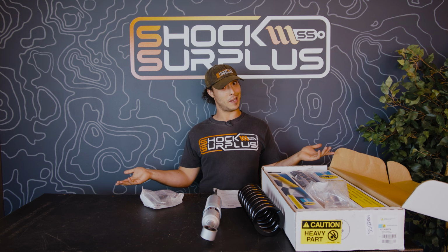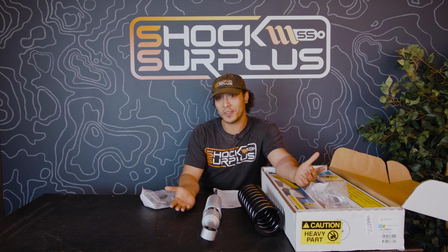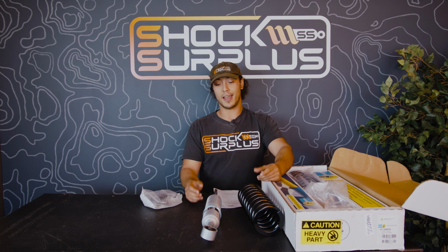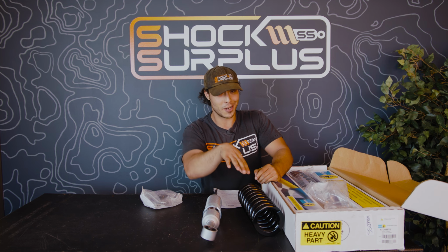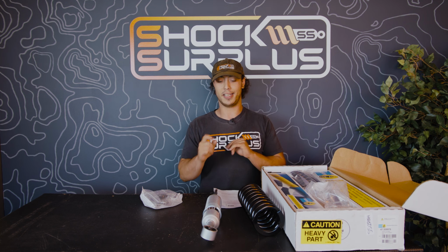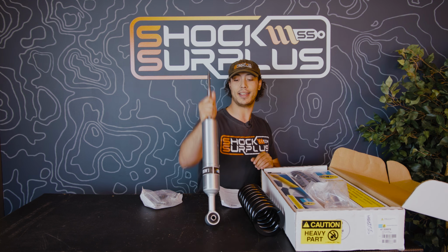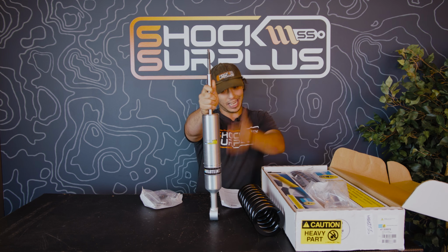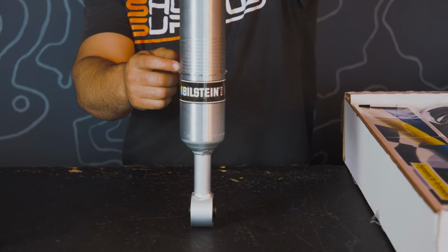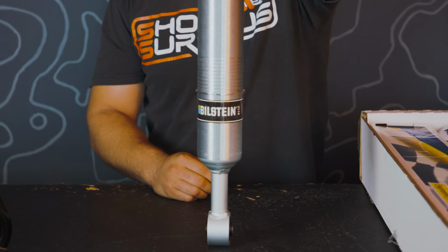You'll be asking yourself, we always love the 6112s, what needs to be changed, and really not much. What Bilstein's done, and the reason why there's only one strut here in front of me, is they've unified all of those different fitments into one nice, beautiful strut. How they've done that is, boom, they've added 11 circlip settings onto this, so you can basically set it up for all those number of vehicles and get the ride height you're looking for.